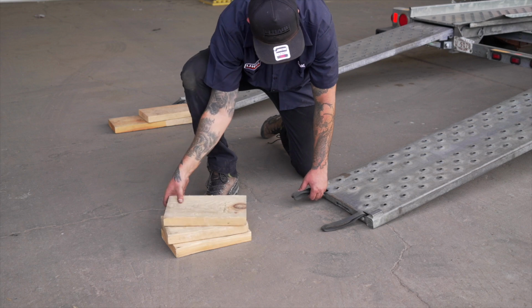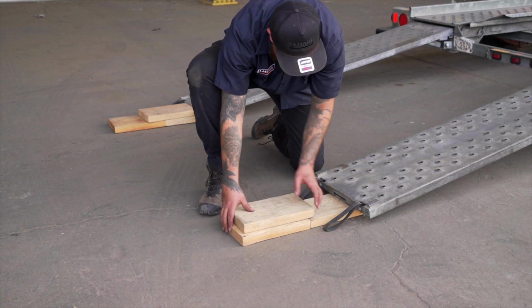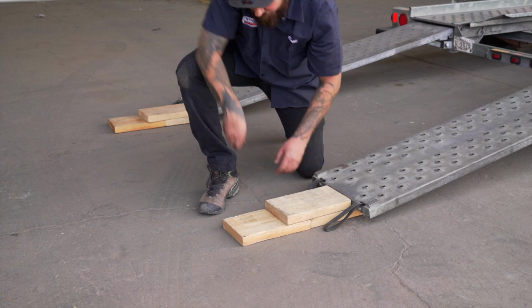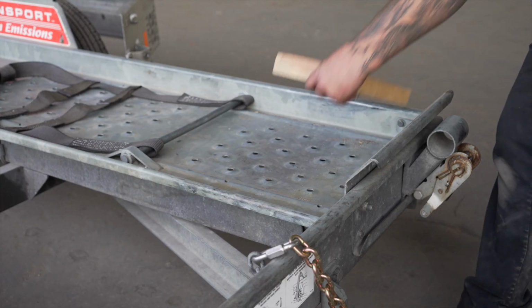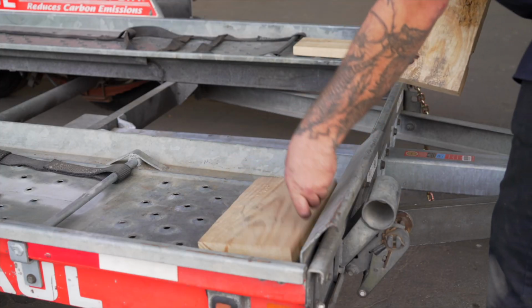Since your vehicle has low clearance, you can raise the vehicle's clearance by laying three 12-inch long 2x8 boards on the ground in a pyramid. Next, place two additional boards in the bucket to clear the tire stops, and then repeat on the other side.